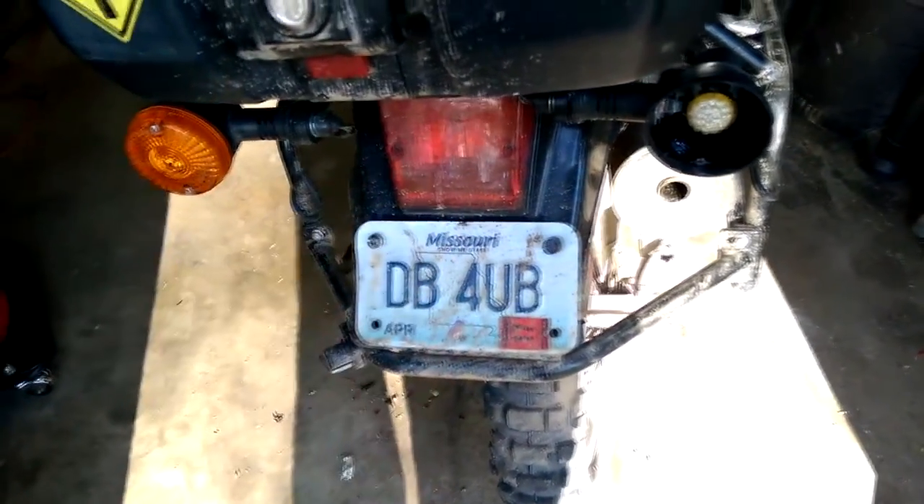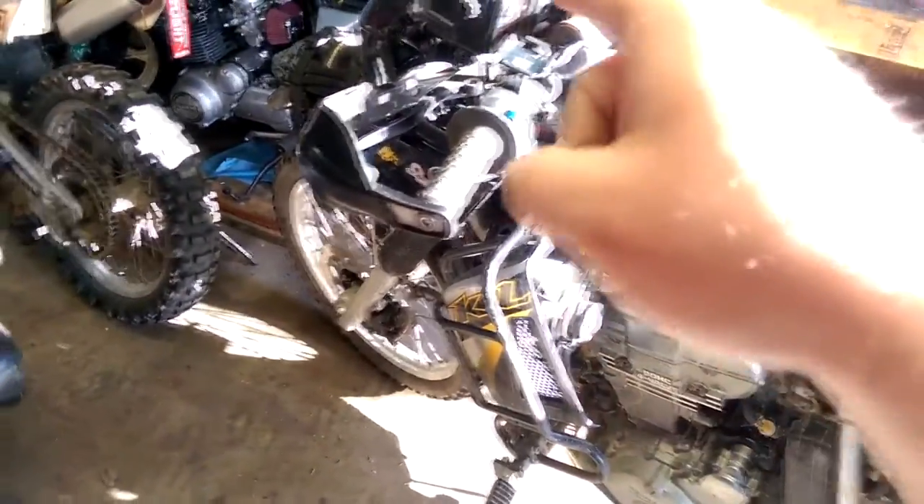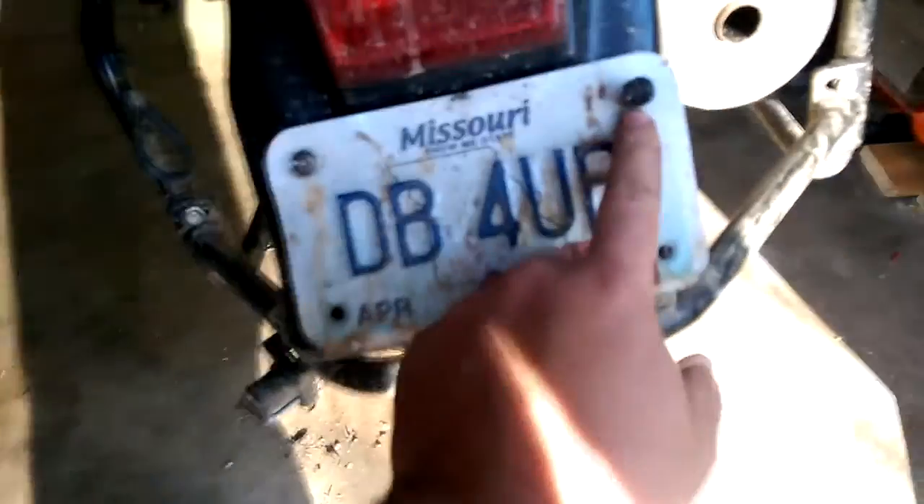Next is the LED brake light — another simple install. You take it out and replace the bulb with one from SuperLEDs. I'll put the part number in the description along with a link to the post I used. The headlight was about $68, around $75 shipped — it's worth it. Don't get the cheap ones; those little ballast boxes go out. Get the Cyclops one. The LED for the brake light is from superled.com. The license plate light just has an LED in it, connects right up, and it works — no diodes needed, plug in and it works.